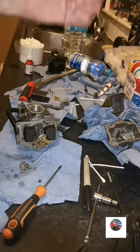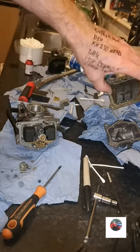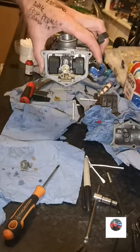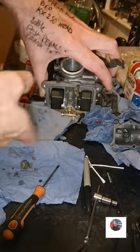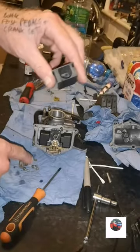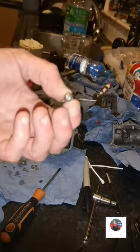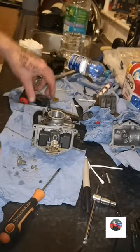The old gasket's off the engine. I'm gonna have to order another gasket for the air because I've got none in. That's all right. I'm going to put the carb on top of the radiator just in case there's any fluid left in it from the ultrasonic, but I'll be flushing it with petrol anyway. Get the needle back in with the two little white washers, two screws. I'm going to put new Allen key bolts in, the bottom three bolts and the top two.